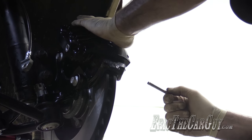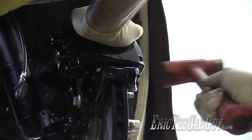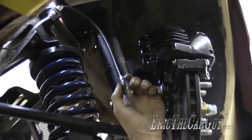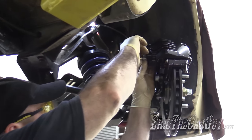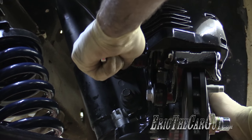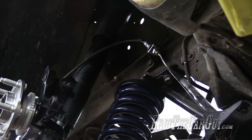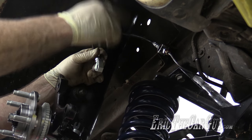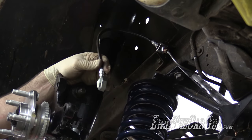One last insertion of the pin. And now we attach the brake line. Let's take what we've learned here and translate it to the other side of the car. I know I want the brake line to attach to the back of the caliper — I want this flat side facing that. It was exactly the opposite a moment ago and I flipped everything around, at least the brake lines, to do that. Because I don't want to twist or stress this in some way — I want this to just hang just like it is right now with little to no stress on it.